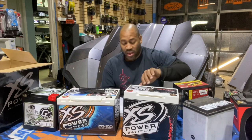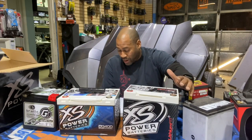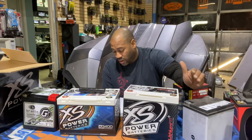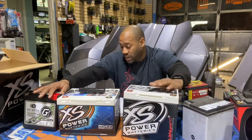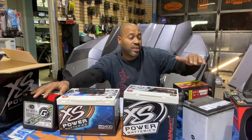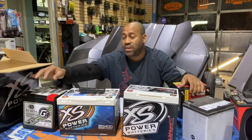LIS 925 claims to be 23.4 amp hours, claims to have 1080 cold cranking amps, and it claims that it could support 5,000 watts RMS. All these batteries claim, all these 30 amp hours, 20 amp hours, claim 5,000 watts. Here at the shop, we like to call them 4,000 watt batteries. Whatever the manufacturer claims, just like Stinger claimed 1,900 watts, we call it a 1,500, 1,600 to be safe.